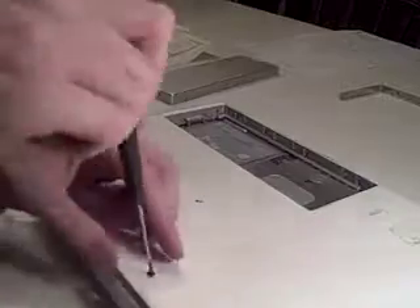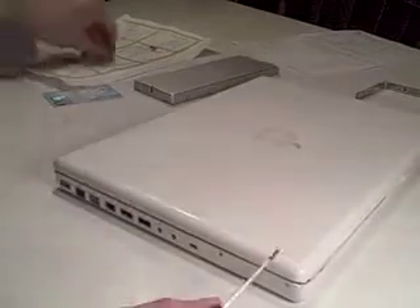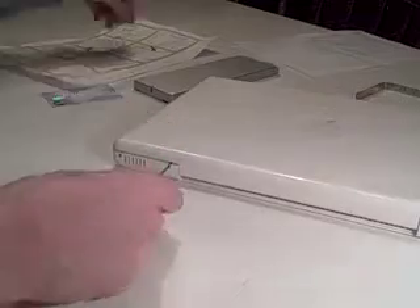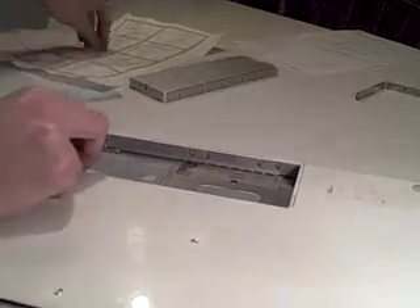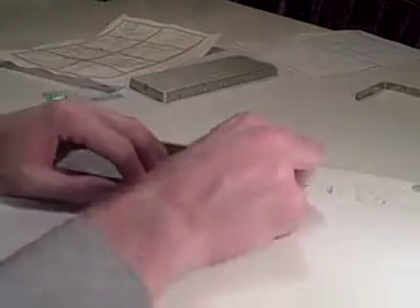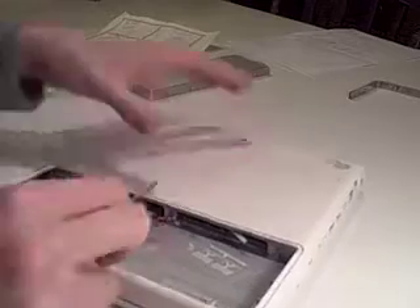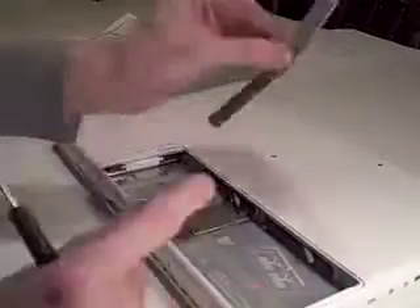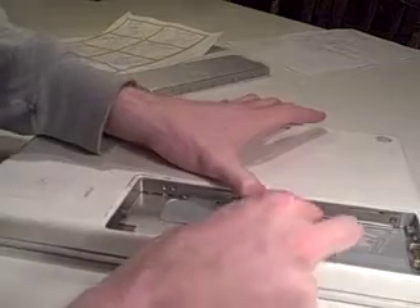Put the bottom screws in — the small one in the middle. Then put the screws back on the side: the ones on the side of the drive are longer, the ones on the other side are the teeny tiny ones. On the back, the ones on the hinge are longer than the ones on the edge. Then put the inner screws back — the ones along the front edge, the two by the battery connector, and the three underneath the RAM cover. At this point you're probably wishing you'd made the spaghetti thing. There's a little notch on the end of the RAM cover, so jam that in first, then tighten the screws and put the battery back in. Jobs done — flip it over, turn it on. Moment of truth. If you're using your MacBook for audio, check out my recording blog at gotmikes.com.